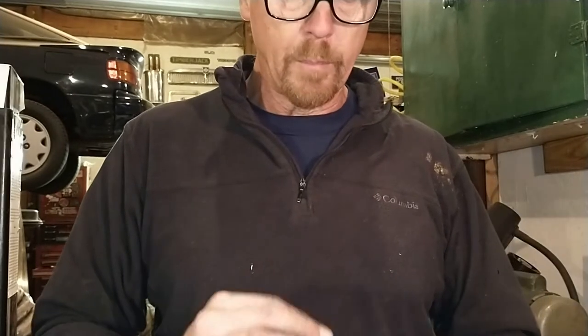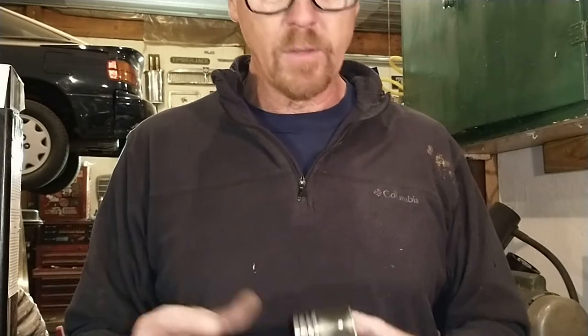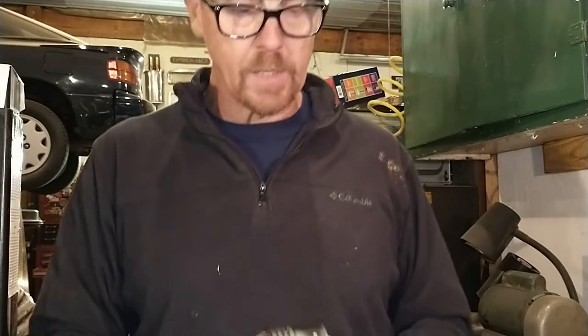Even after all the machine work, it's very important that I don't have any edges or burrs that could potentially poke through the film of oil and score the cylinder walls. I mentioned on the last video that somebody cleaned off the Teflon — that Teflon is supposed to be there; it will wear. If you look closely at this piston, you'd see grooves kind of like a record from the lathe work. Oil generally fills those areas, but because of such a short piston and small skirt area below the wrist pin center line, the Teflon reduces friction if we get any skirt slap.